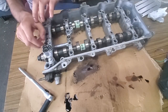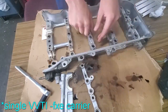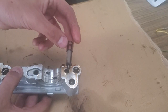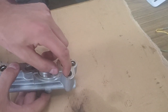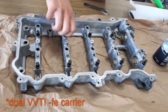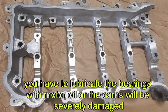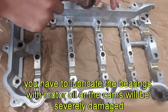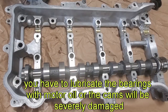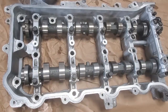The next step is replacing the cam. You will only need an identical intake cam and phaser from the same engine, and that will be put into the exhaust position. The main problem is actually getting this camshaft — they are much rarer than the FE camshafts. The cam profiles look almost identical and the part numbers are very close together, so it's easy to mix them up if you're getting them from a recycler, which is how I got sent the wrong cam. Unless you live way up north, your best choice is to take apart an FXE at your local junkyard. They can be gotten very cheaply as there is almost no demand for them used, but they are about $300 new.